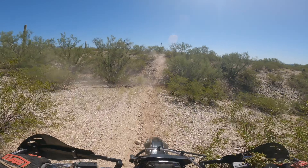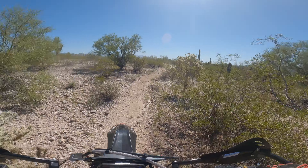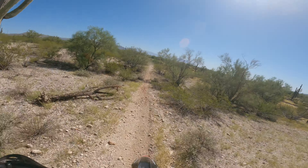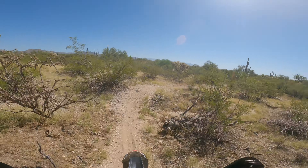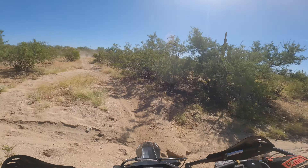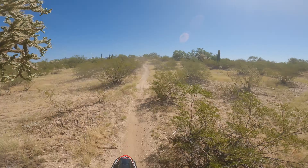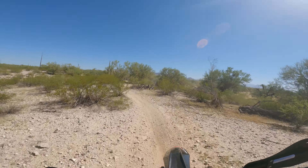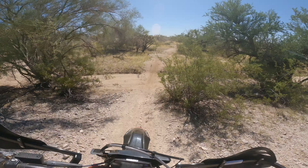Had to adjust a lot of play into the throttle cable on this bike — it had almost none. On a 300 with this much power, you do not want a throttle cable with no slack. I have the cable adjusted all the way in and I barely have minimum throttle slack. That's why I've been riding it in rain mode — I want to get a feel for the bike and I don't want to loop it out. It's Teddy's bike and I don't want to hurt his brand new machine.